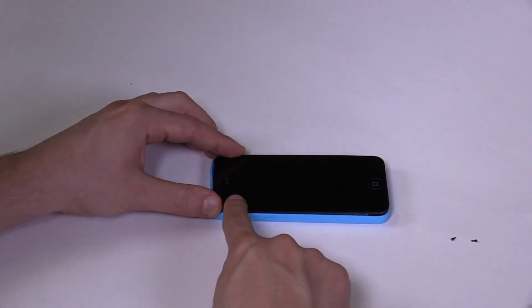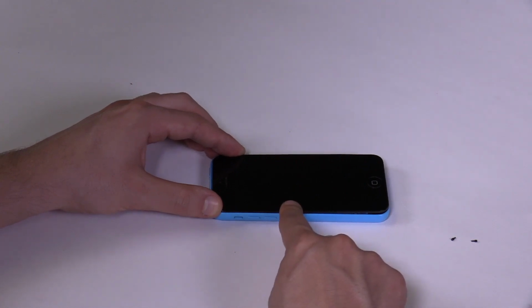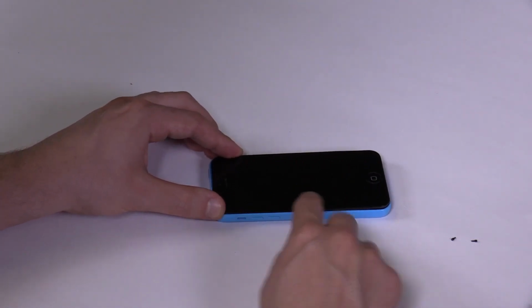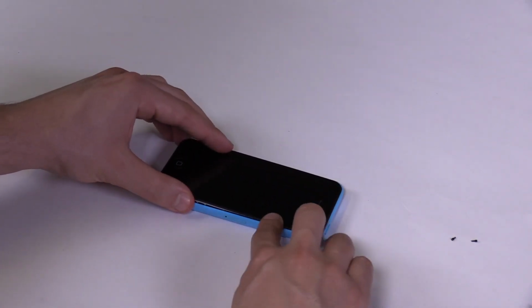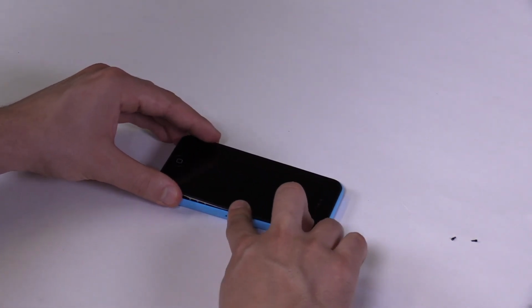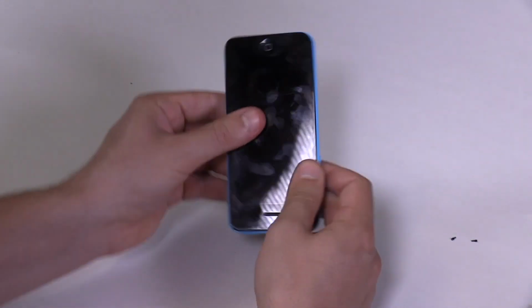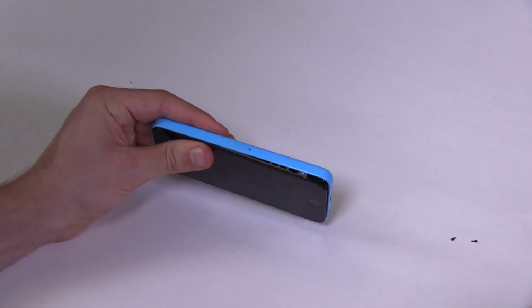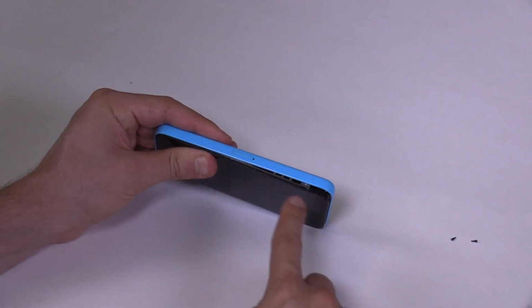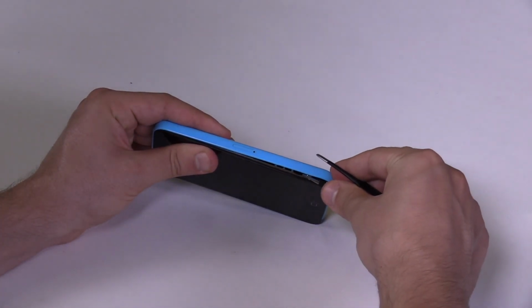If your phone has been dropped, the back assembly can be a bit skewed and it may make it a little bit more challenging to assemble the phone. Keep in mind that you're dealing with a part that is made out of glass and you can only bend it so much. If the part appears to be stuck, lift it to a 90-degree angle and try again. The small notches on the side will snap into the back assembly as you go along. You may assist with the tweezers.